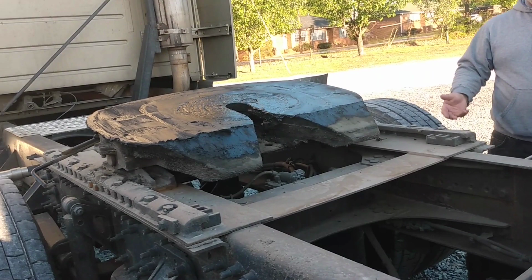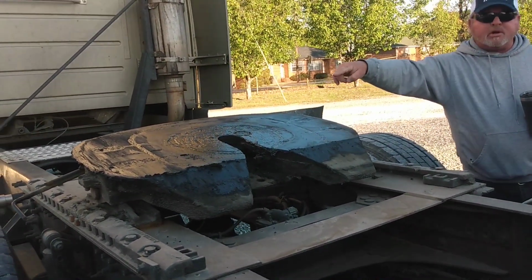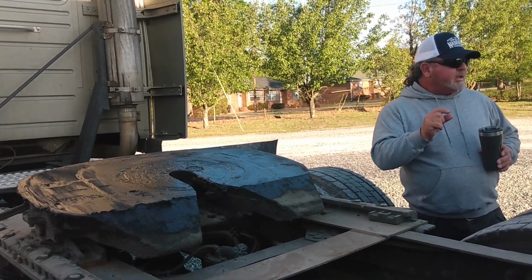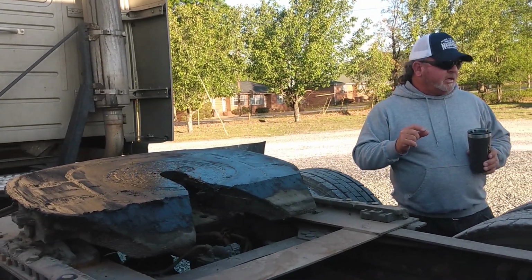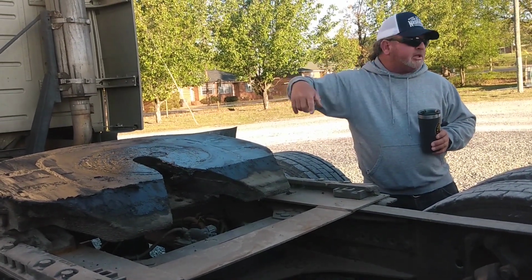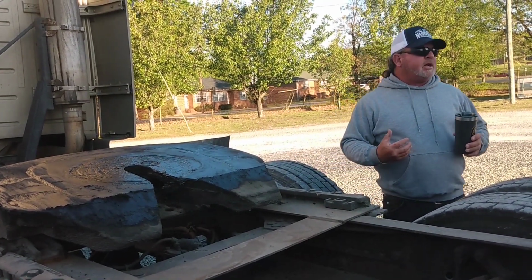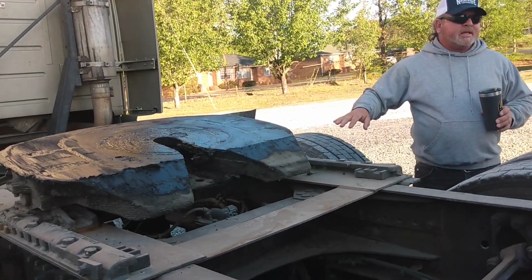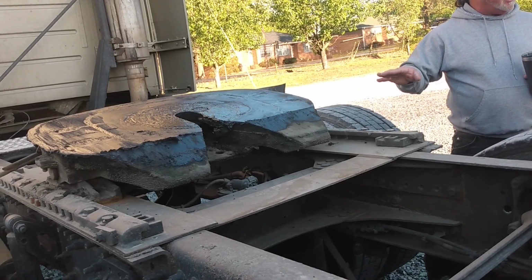If you get your truck washed, or you see a spot anywhere on your trailer, on your 5th wheel, that's as shiny as a nickel, you got friction going on. You need to put grease on it, alright? It ain't got to be pretty. Run it by the shop, they may just squiggle it on. Around here we use a bulk container and a drywall spreader, like icing a cake. It ain't got to be pretty just so it's on there, okay?